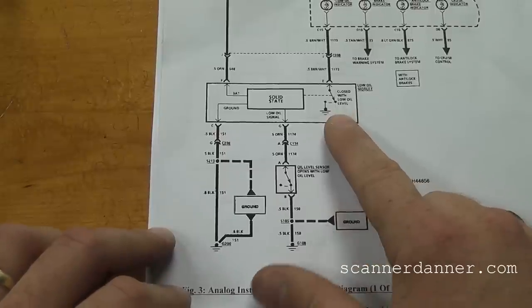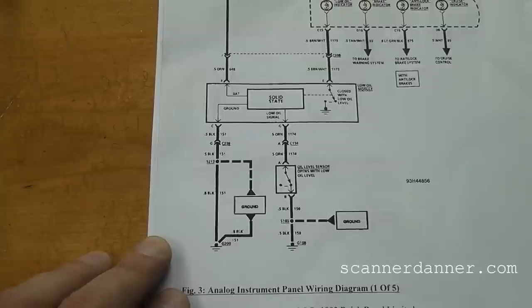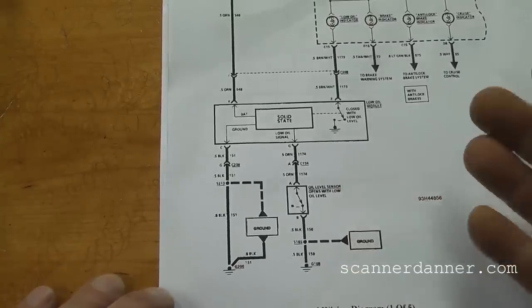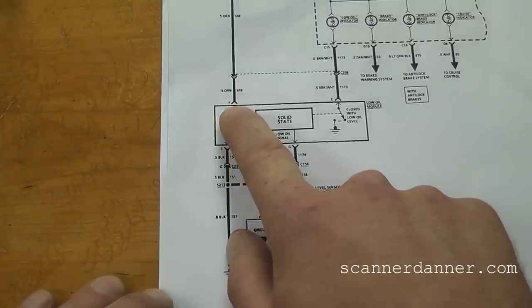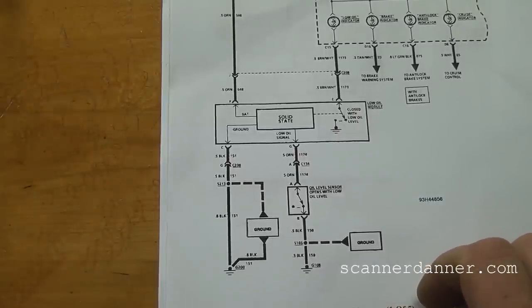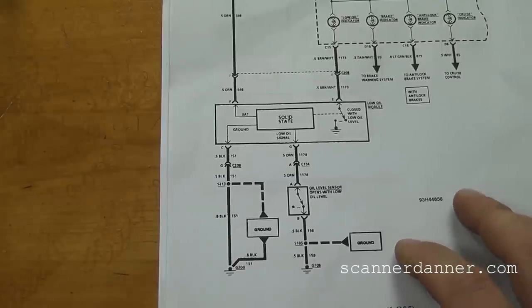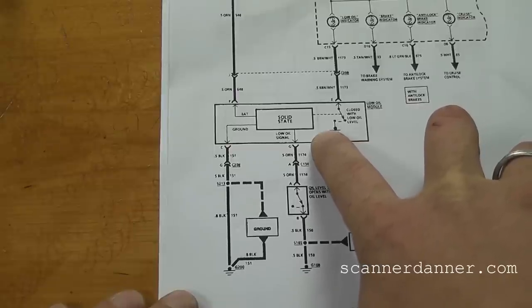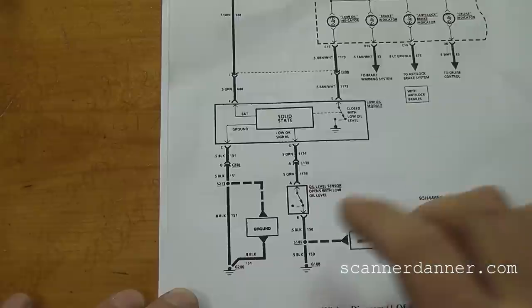We never found it. We went all throughout the car. We actually used Google and found pictures of them on eBay with the right pins supposedly on this vehicle. We were debating how many wires are on this module. The diagram showed connectors labeled F, E, G, and C — meaning more than four pins but only using four wires. We guessed it was a seven-pin module, and sure enough found pictures on eBay confirming that. Mitchell showed this module in the passenger front behind the glove box area, so we pulled the glove box out and dropped the lower panel. We couldn't find it.